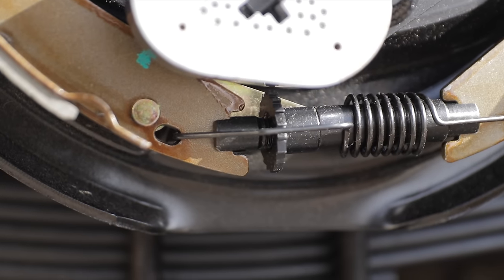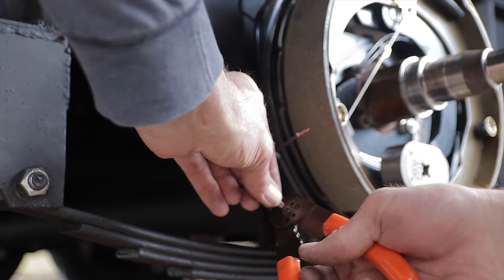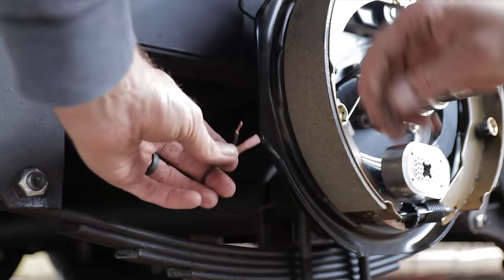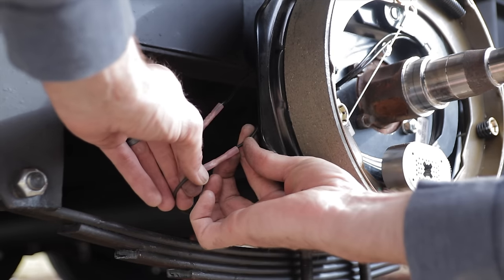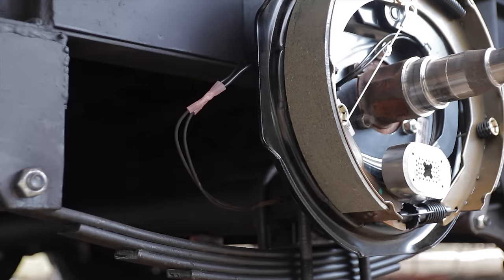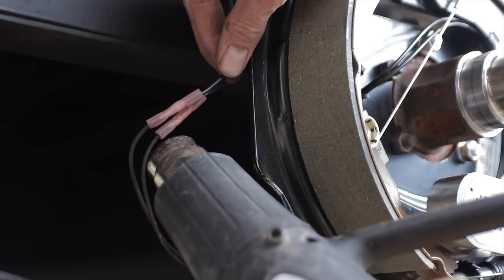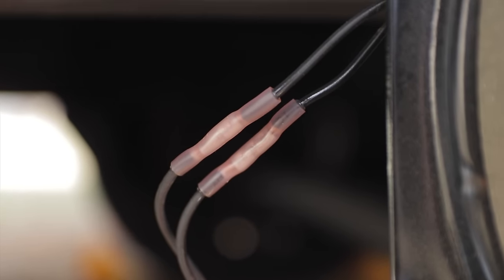With the new auto-adjusting brakes we're putting in, every time you brake going forward it auto-adjusts, so you don't have to do this all the time. Now we can finish installing the brakes by connecting the wires. There's no polarity on the wires, so it doesn't matter — that's why they're not color-coded. We're going to connect both wires together with butt splice connectors, which are a heat-shrink type. We heat those up with a heat gun and they give a nice weather-tight seal on the wires. That's it for our brake maintenance and brake assembly.